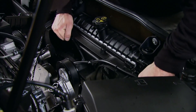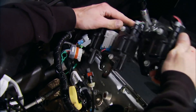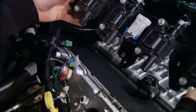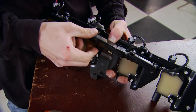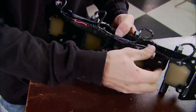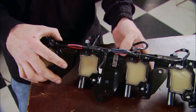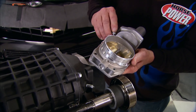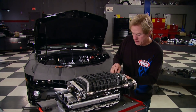Reinstall the fans. On the engine, remove the coil packs along with some additional pieces as detailed in the instructions. To give clearance for the supercharger, remove the plastic wire loom covers from the coil packs themselves. With that done, transfer the throttle body and MAP sensor to the supercharger.